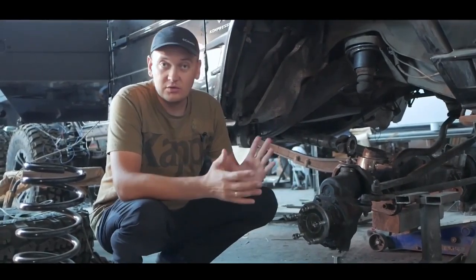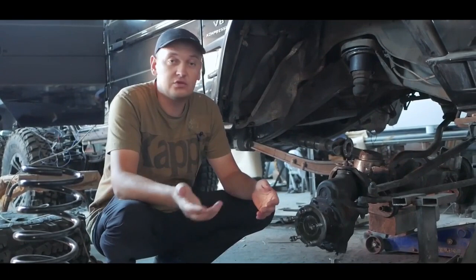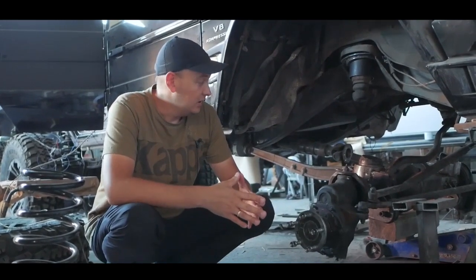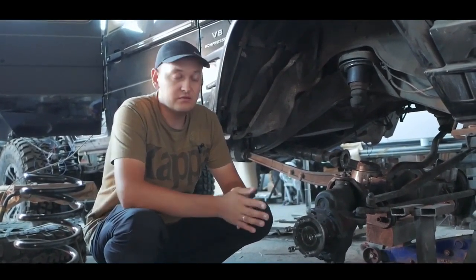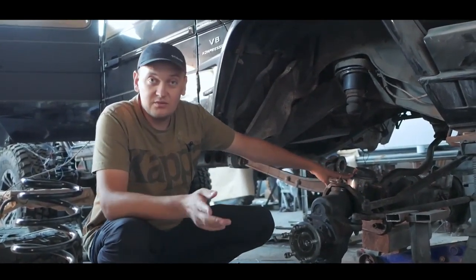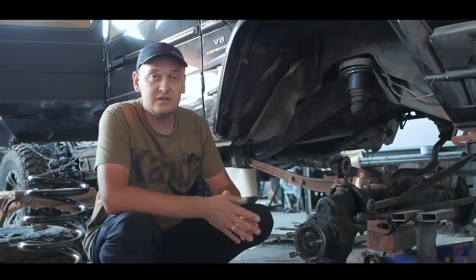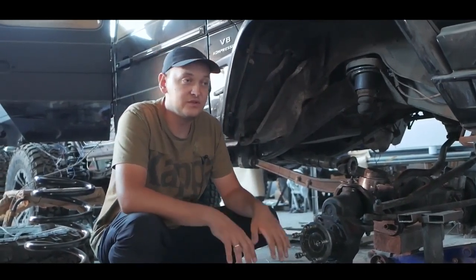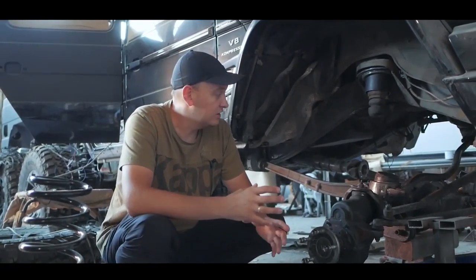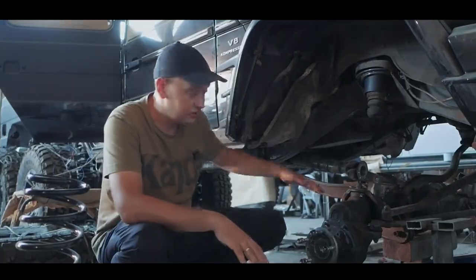I will say some words. Usually guys ask me about making a cheap body of G-Wagon 6x6 on original axles. In theory, you can. I sold a back body of 6x6 on original axles. I think you could see it on Ukrainian sites. The owner wanted to lift it up and put 47 wheels, but he didn't get the needed height. You can see that it is low and with big wheels, and the car started to ride very tough. He put very tough springs and very big cups, and he has a big angle of traction. Of course, we won't have this because we are using raised portal axles. In fact, you can do it, but the car changes in control and gets very tough.